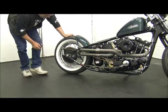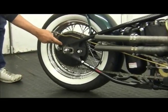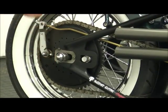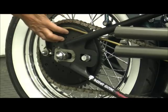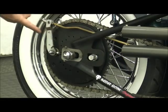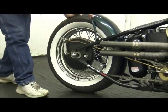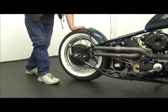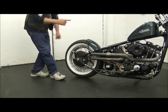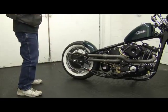Moving back into the brake again, you'll notice all the holes drilled here. This is ventilation. The brake will get hot, it will fade being a mechanical brake. It being the only brake we have, I'm pulling cool air into the brake. Also through the actual drum, there's holes drilled around that, kind of like a disc rotor, which makes better stopping power. The back of the drum also has holes drilled in for exit of cool air in, warm air out. So it's a pretty nice brake setup. The thing stops very well and kept it very clean looking, which is what we were going for.